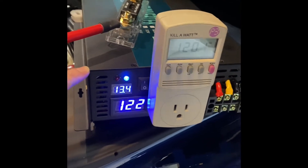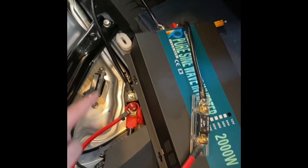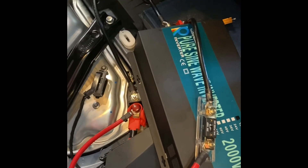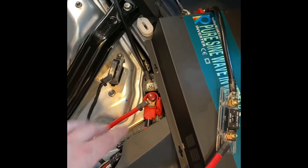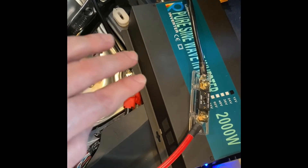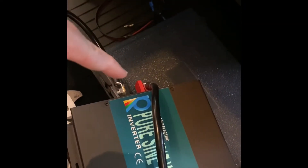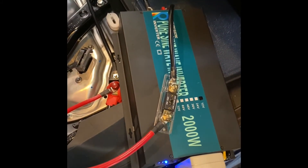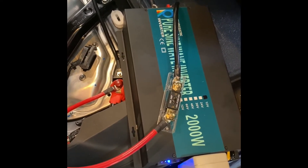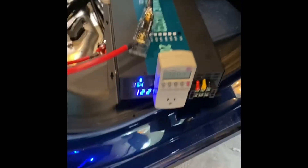I had to do this a little tricky: it's plugged directly in on the positive terminal and directly on the other terminal for negative. This is the step-down converter from 400-volt back down to about 14 volts — it's detecting 13.3 here. I wasn't able to plug directly in initially because the capacitors would trip it. What I did was go from the fuse to this resistor, then from the resistor back, measured it at 14 volts — confirmed it was getting power — let that sit for 20–30 seconds, then immediately removed the resistor and plugged directly in.